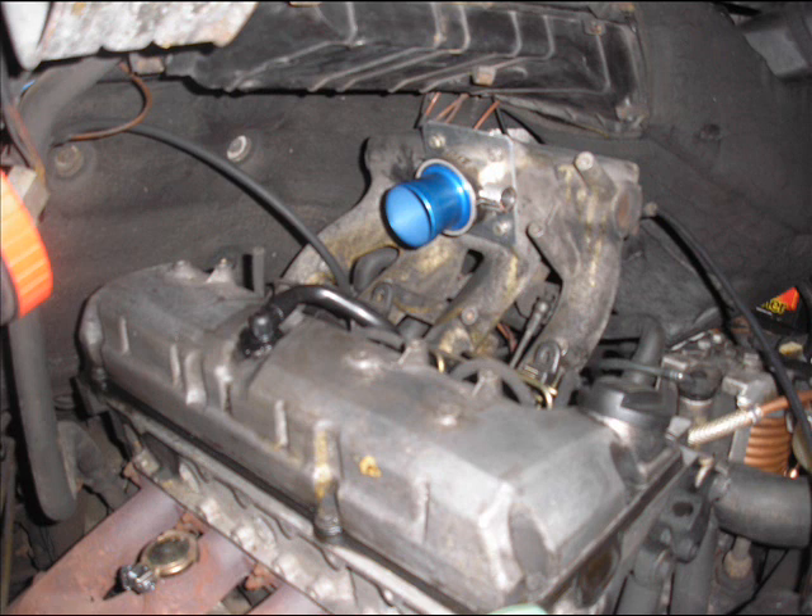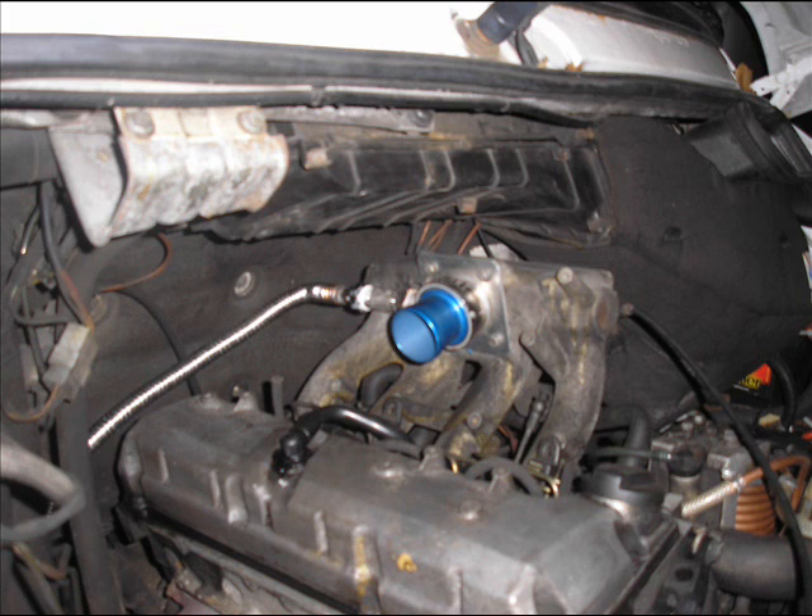Basically the venturi's on there the wrong way round. The EGR valve I've removed and you can see the cap on the exhaust manifold. It's an old engine — it doesn't have a computer. I'm going to move the EGR valve near the back, in front of the tiny catalytic converter — it's an Eberspächer catalytic converter on these Mercedes Sprinters, the old ones. I'm going to attempt to fit that and feed water in when the engine is actually asking for an EGR, so it'll be squirting a bit of water or vapour into the catalytic converter, hopefully to shift and dissolve some of the leftover rubbish.